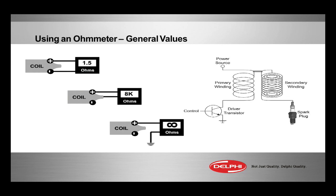At the very top of that schematic, where you see the primary and the secondary winding, we see a connection — and we'll see that with the ohmmeter. We see where that secondary winding terminates at one end on the spark plug, and on the other end typically at the primary with the source of the primary. That can all be checked: it might be 1.5 ohms, 0.5, 0.6 — it doesn't matter. We're looking for an open circuit or hundreds of ohms; that would be abnormal, that would be a coil that would not fire, there would be no spark at all, and definitely DTCs for that cylinder.